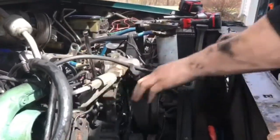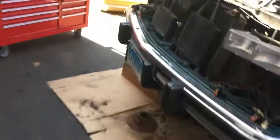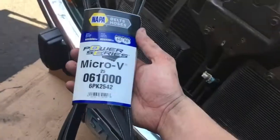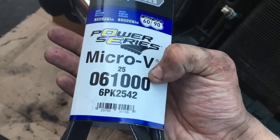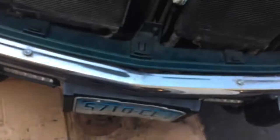It's a beautiful Friday — day three in a row — it's like 81 degrees, which is almost a little too warm. But today we finish the truck. Radiator's in, hoses are connected. The factory serpentine belt length is 101 inches; we got rid of the vacuum pump and everyone said to run one inch shorter. The 100-inch belt is still maxing out the tensioner throw, so we're going to try a 99.